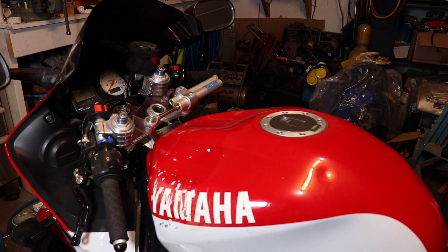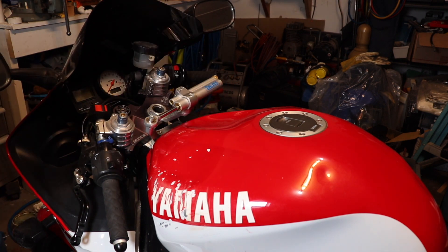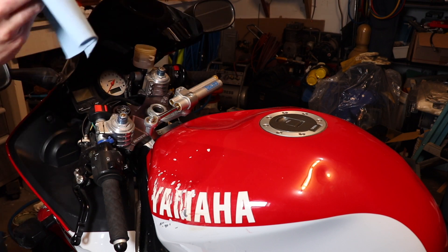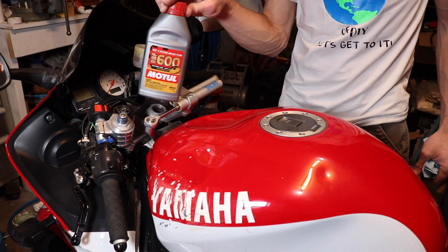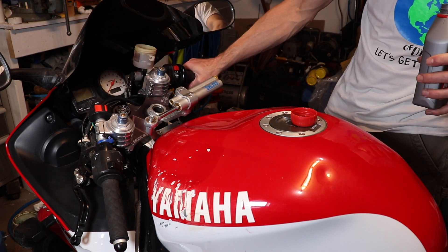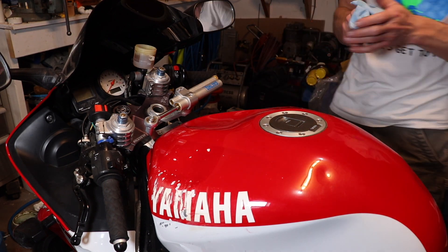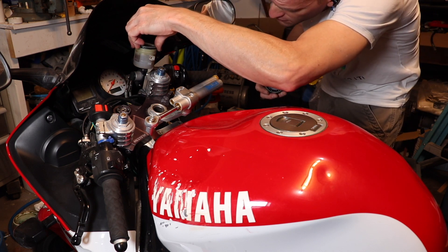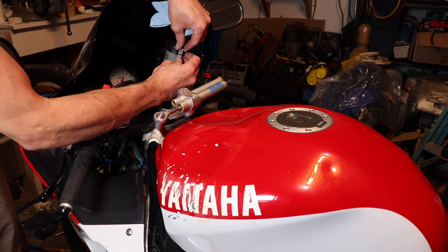Now I'm going to add some brake fluid. You want to turn your handlebars all the way to the left so your reservoir sits level. Then you remove the Phillips head screw on the hold-down clip and loosen the cap. I keep a rag close by to catch any brake fluid. I use Motul brake fluid — they have the best brake fluid in my opinion from when I was racing, and this is not sponsored. I fill the reservoir and then I pump up the brakes to get all that fluid pushed down into the calipers and get the brakes set against the rotor. Make sure that you always pump the brakes back up before you take it on a test ride.